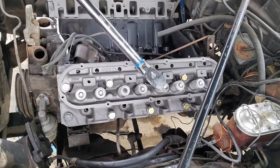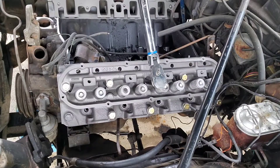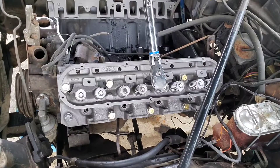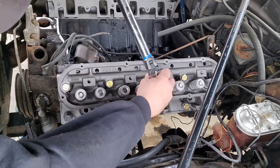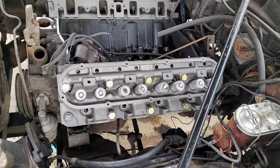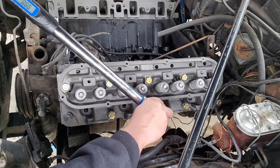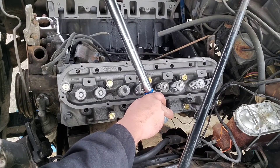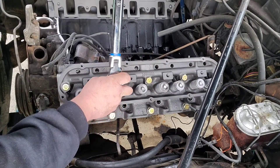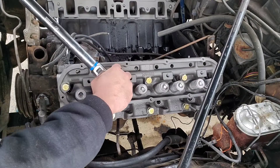We've got a three-quarter inch socket on our head bolts here. 115 is going to get pretty tight in here. See the green marks coming up — I like to go back off a little bit. Nice solid tone there. Then flip it around, hit clear, and just come back and do the next one. That was 1, 2, 3, 4. You can skip arms and chest on days when you're torquing head bolts — no need to work those anymore.